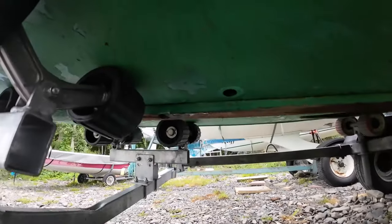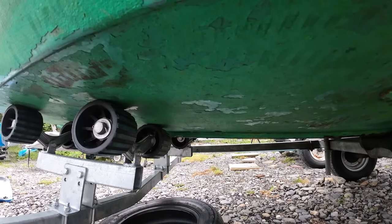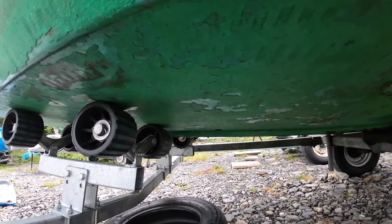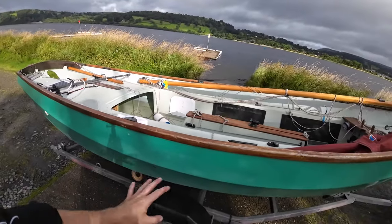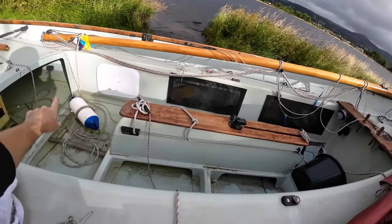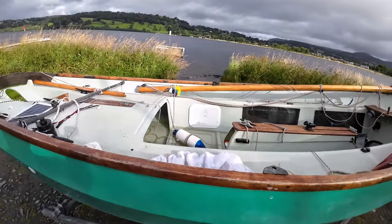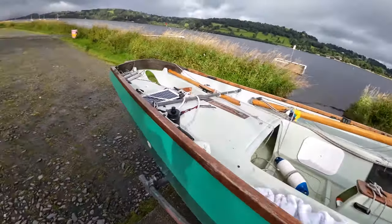We are starting to work this out — we've got water over those screws, and sure enough you can see the drips coming out still. If we play about with that the drip comes out more. I'm not happy, but I'm happy that we know what that is. Let's get the boat on the van, move it about, and get it tilted the other way. See how all the water has now gone over there — that should be enough to check the other crack.